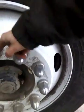You check your lights, make sure your mirror's secure. Same here. Make sure your frame's good. All that's secure. Make sure your lug nuts are secure. Make sure that does not leak. And same here, make sure your door opens and closes. Make sure your mirror's secure. Make sure your steps. These are the primary and secondary tank. You pull them. No oil in the water, no sludge, drain valves closed.